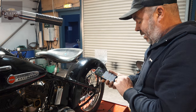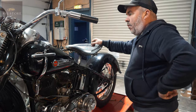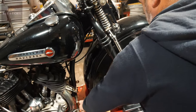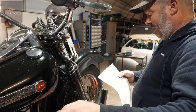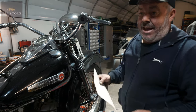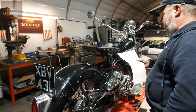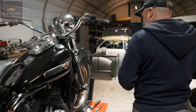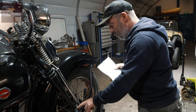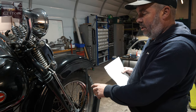So just lots of little bits I've gone through to find out what it is. It's got the wrong carburetor on it — it's off a much earlier bike. Wrong speedo head. That front support bar is wrong, but only by an eighth of an inch so that ain't going to make the slightest difference. Rear mudguard braces are correct for 1946 onwards — I think it might be a 47 mudguard. The rear stand clip is wrong — that's off a WLA, it should be longer. The front wheel's wrong; that's a big twin or WLC wheel, which you can change at a later date. It's a bolt-on, it shouldn't be — it's an interchangeable wheel; only Harley WLCs and big twins are those.